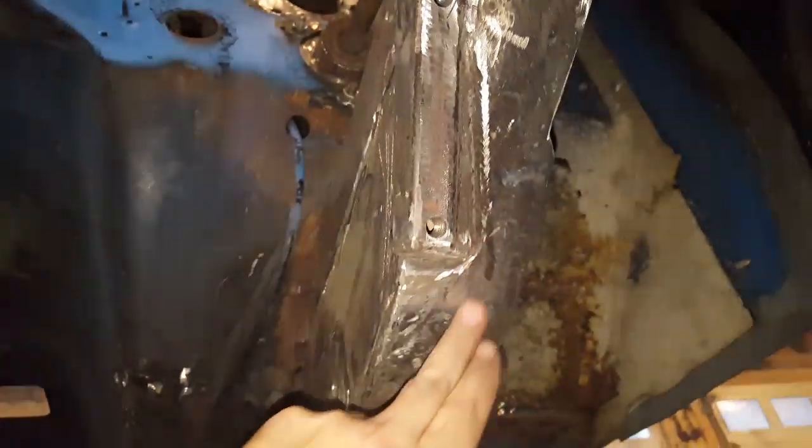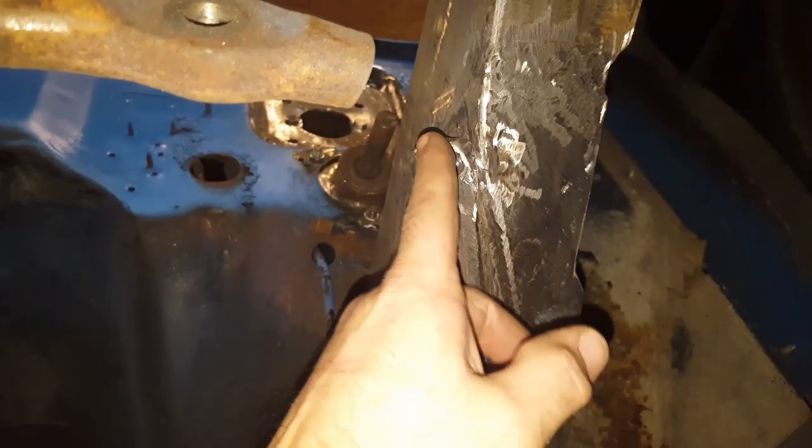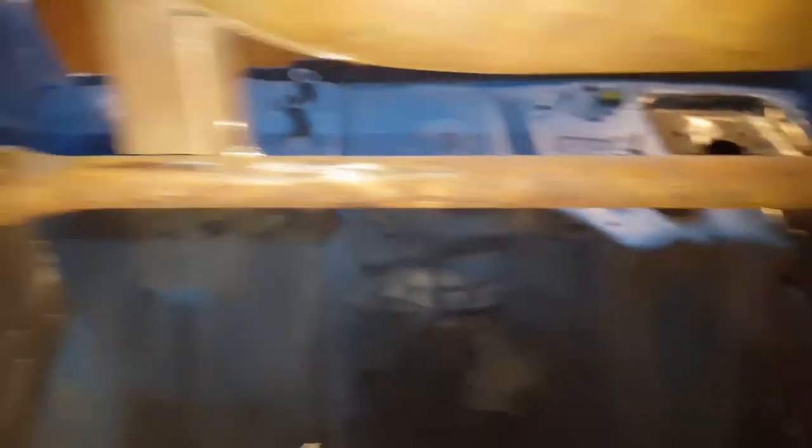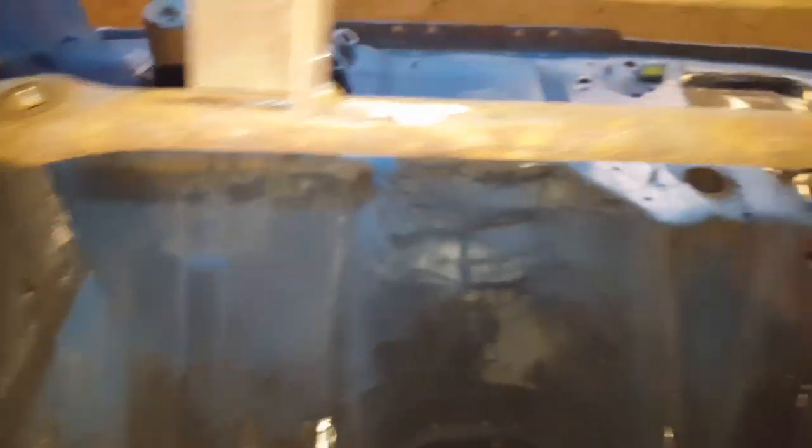I cut the bottom out of this when I first started - I had to cut out the whole bottom rail to do a nice job so I could weld this back in again, because I had to move it over. You can see I had this section here and I had to move it over seven-eighths of an inch to get this to center. Now that's all done, it's time to move on to the center link - make the bracket to go from here to the rack.